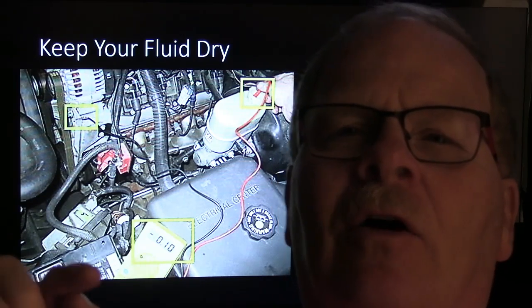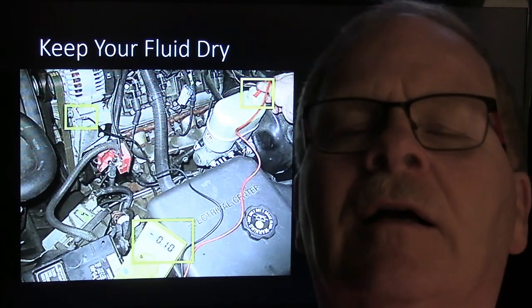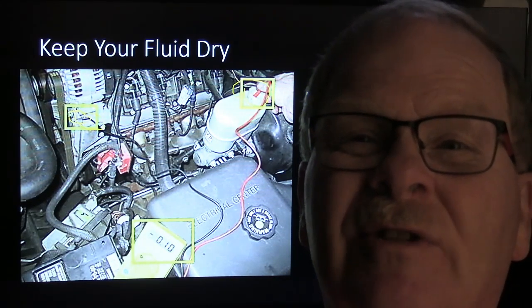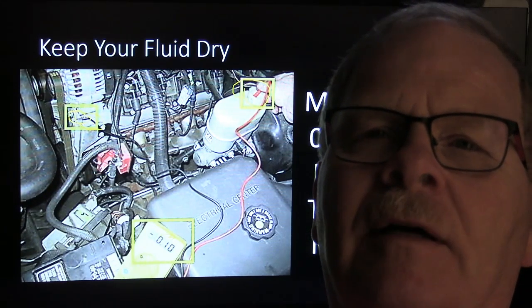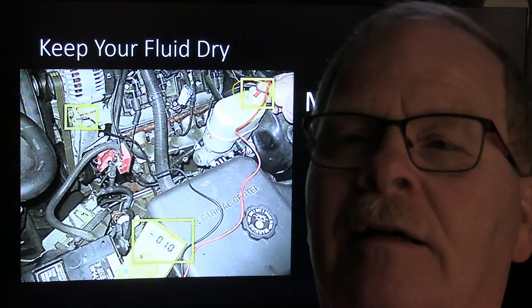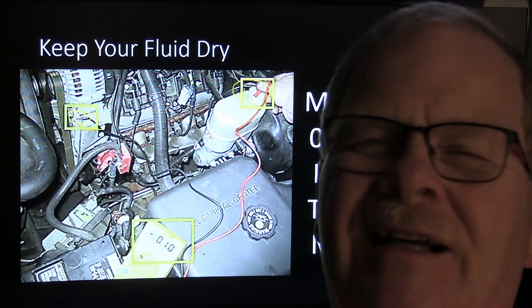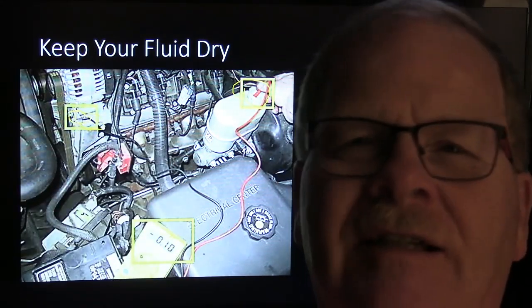There are also these Phoenix Systems test strips you can buy. They cost about $1 apiece, and I think there's a box of 70 of them. It's their FASCAR, F-A-S-C-A-R, which stands for Fluid Analysis by Stimulation of Copper Alpha Reactions, because copper becomes a problem in brake fluid. Copper in and of itself tends to be corrosive. Elements in the brake system have copper in them, brake lines particularly on the inside, and some comes from other places. If there's too much copper in the brake fluid, the fluid, which we all know gets dark over time, will show it. When you dip the strip in there, you look at the various shades of purple and compare it. It's a dip strip.